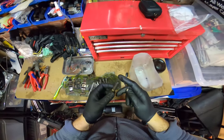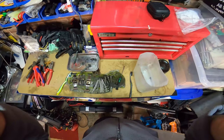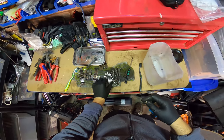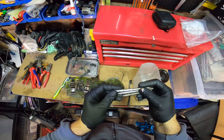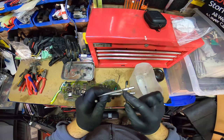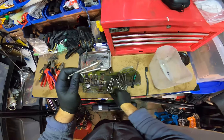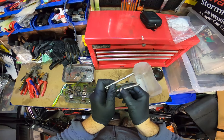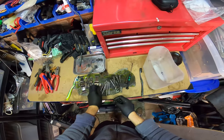This is why you need to maintain your brakes, because of things like this, right? If you feel, there's one that's really badly scratched. See all these bits there? I don't know if it's picking it up nicely on the camera, but those are wear marks, and some of them are quite badly indented where they've maybe stuck on. Like there's one, it's quite a big dip. That just means the caliper won't slide nicely on there.